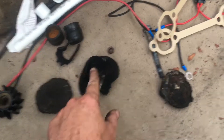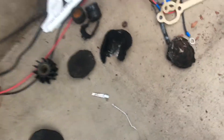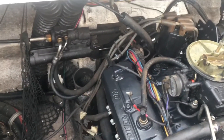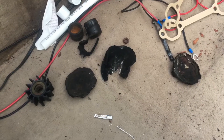And there's a good reason for that. These are used, melted flappers that I pulled out of the exhaust system — down in the bottom of what's called a bullhorn, where the two sides join together in the middle and go out through the outdrive. Just inside the bellows of the outdrive, I found these three flappers.